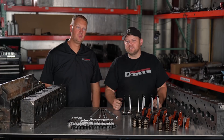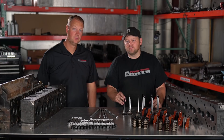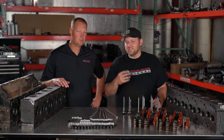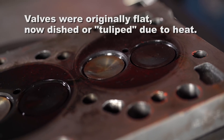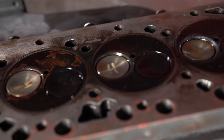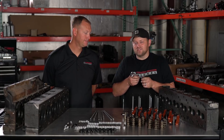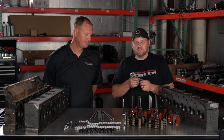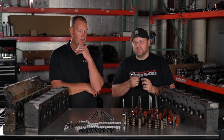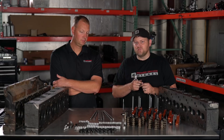If you remember back at UCC, we bent all of our high-performance valves and were forced to use stainless steel valves on the exhaust side — big 1-11/32nds valves, but stainless. Let me show you what happened to the head when we overheated the valve. As you can see here, these valves are totally tulip'd. What was our max EGT? About 1,600–1,620°F. And look what happened to these valves on the sled pull. We have the correct Inconel valves in stock for the Warhead, so if you need them, give us a call — you don't have to search anymore.